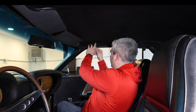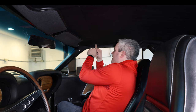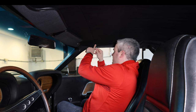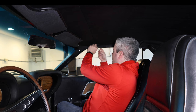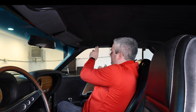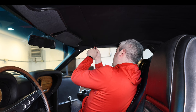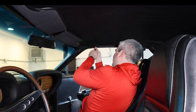You can see I found one correctly — it went all the way through the metal. Since I found that one, the other one is going to be immediately below it. Above it won't be correct, so it's below it. Now that I have both holes in place, they're really small — you can barely see them. They blend in with the headliner. So I'm going to use a screw to open up the top one, and then open up the other one a little more with the dental pick. You can see that's threaded correctly and going into the right location.